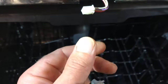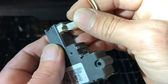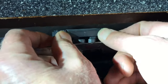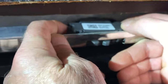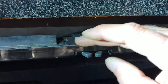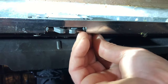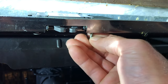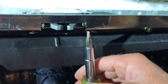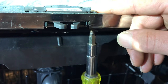There's a little tab on the back of the connector — pop it out, there's the old switch. Here's the new switch; everything matches up visually. Push the wire connector back in for a nice firm fit, then reinstall — slide it back into position behind the dishwasher, get the trim piece lined up in its little groove, nice and flush with the top. Line up the screws and start them by hand first to make sure they grab the plastic — these are sheet metal screws cutting their own threads in the plastic, so make sure they're straight before using your screwdriver, then tighten down snugly. Don't overtighten or you'll crack the plastic.